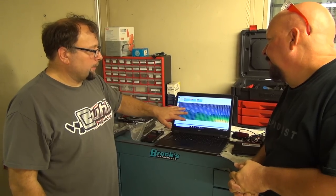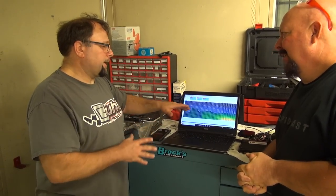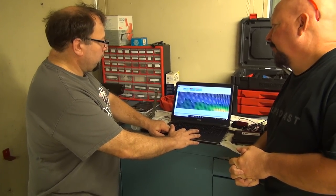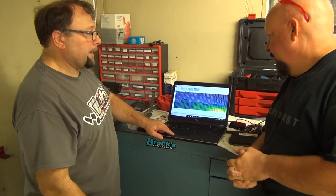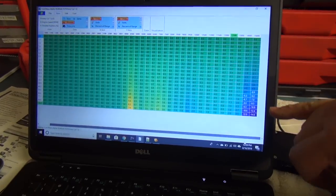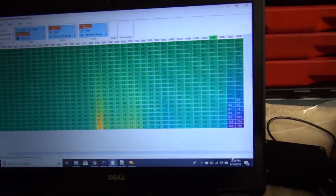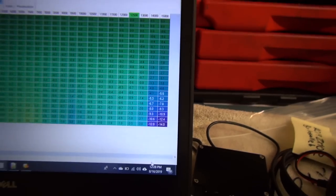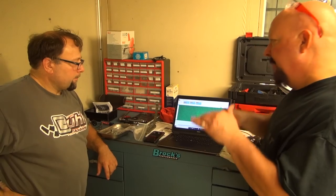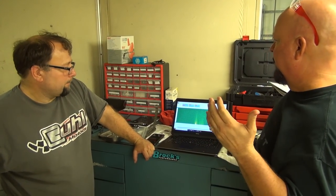It's interesting to look at. If you see massive color changes, it points out glaring issues. But most of the time you're going to be looking at the percent change, like how much fuel you're adding or subtracting. Over in this area where we were crazy rich, you can see the purple. It shows we've made some pretty large changes there, and some more minor changes through the middle just to smooth things out. That's what my mind understands, because the software allows us to understand that.